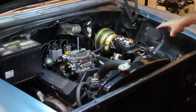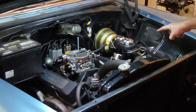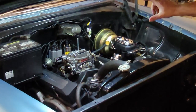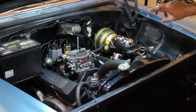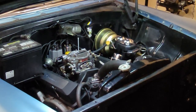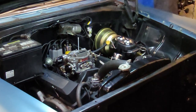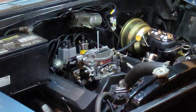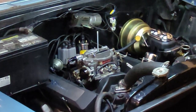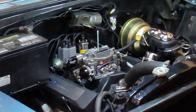And we had that one bad wire to the number 5 cylinder over here that was wrapped around the shifter. It has a little damage, but it's not broken or anything. It's just a little marred up. I don't know if that's going to be an issue or not. Once it fires up, I'm going to see if it runs for a minute, shut it right off, and check for leaks.